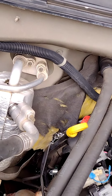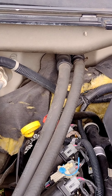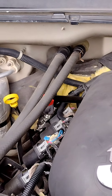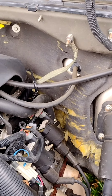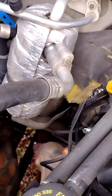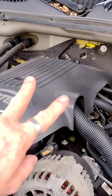If you're going to do the testing or leave the sensors external like I did — you can see the aluminum foil down there by the dipstick. I opened up the wrapping around the harness so I could stretch it from right to left, then wrapped everything in aluminum foil and electrical tape. Under the intake it's not as hot as it is by the exhaust manifold, so you want to make sure you wrap those wires really well to protect them from heat.